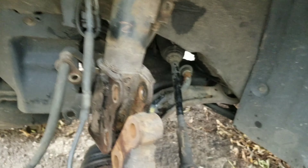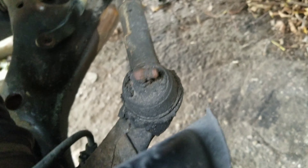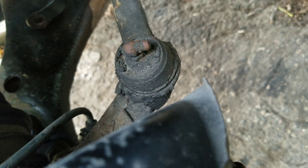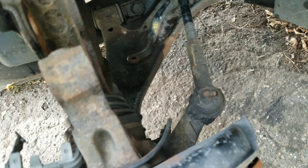We can just pull the shock out now. Like you can see, the braking system is still intact, CV axle nut still there, tie rod still there — even though I do have to go change the boot. Same thing with my ball joint boots — completely shot. So I'm gonna order tie rod ends and ball joints for both sides and get those done before winter hits.